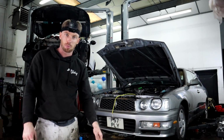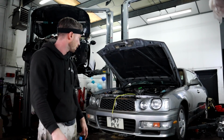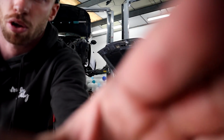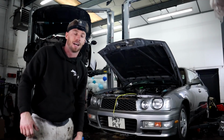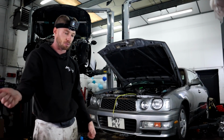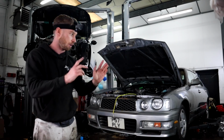We're going to crank it probably a few times, just to let it out. Now, when we did the oil pressure on here, it actually registered oil pressure pretty quickly, so we don't need to be cranking it for ages. I'm probably going to crank it for like 5-10 seconds, stop, and just keep doing that a few times, just to make sure you have a lot of oil.